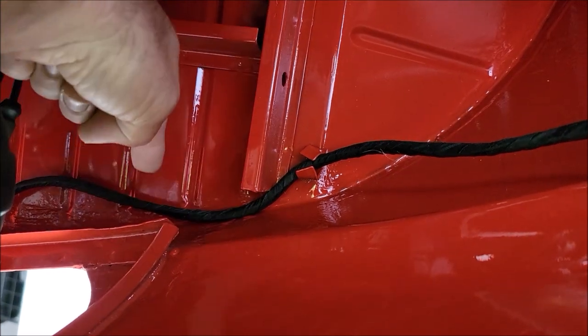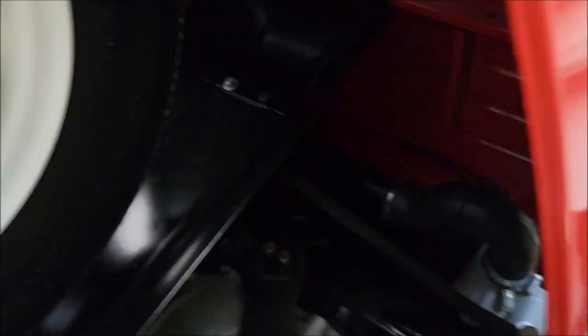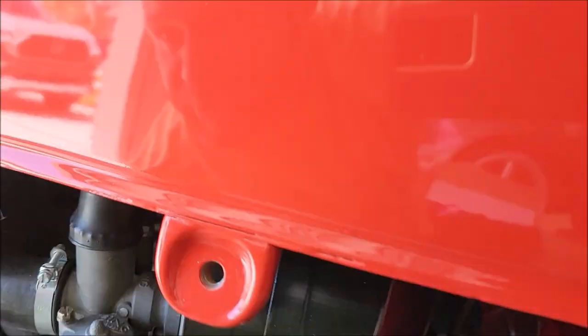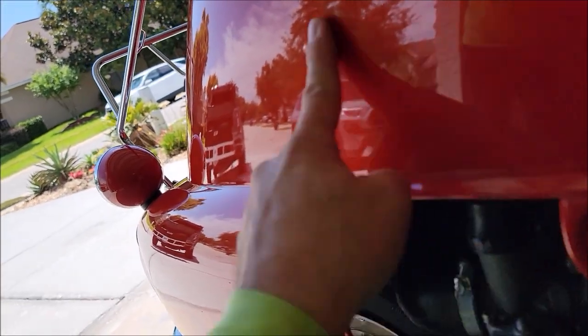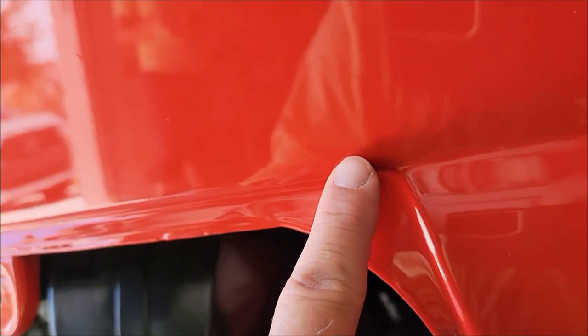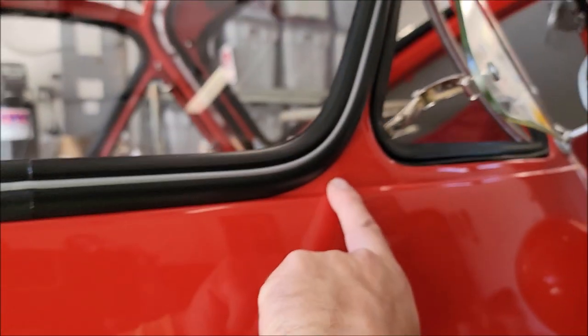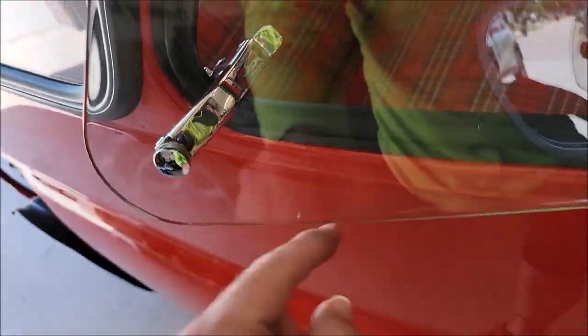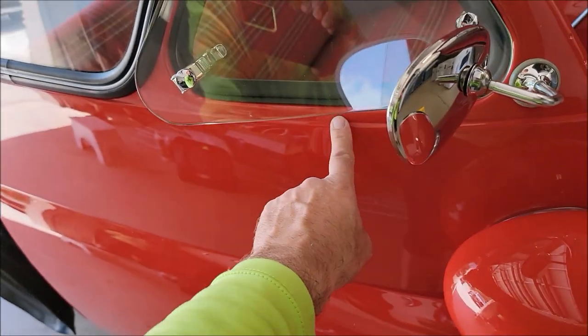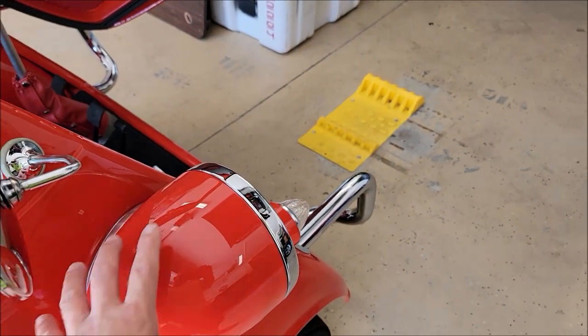You can hear all the Bondo in it versus the metal when you tap — very different sounds. I can see up here where they worked it but it just looks bad on the outside. See how amazing the undercarriage looks — everything's brand new, looks awesome, fuel tank up there. Got to try to address this; there's a big scratch right there I'll try to get out. They did cut and buff this because there's some orange peel around here and the bigger spots look fine, so I'm going to avoid cutting really deep.